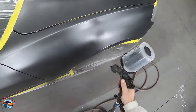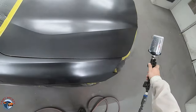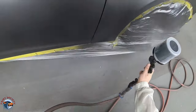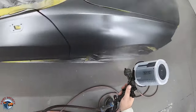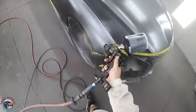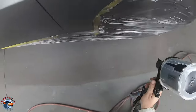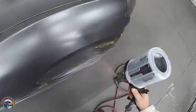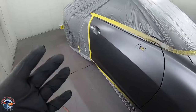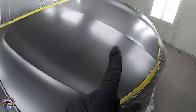I have a couple of cut-throughs — you don't need to seal these up. I'm just going to apply my first coat very, very light. This is the Walcom base coat gun 1.2, one of the best base coat guns I've ever used — it is effortless. I've got around five to ten minutes between coats to allow that base coat to really flash. In the second coat, we're extending a little bit further, going past the panel line on the fender and the door, extending to the first body line in the hood. In our third coat, five to ten minutes later, we extend three to four inches past our original area. Using an extra slow reducer, this base coat blends flawlessly and effortlessly into the existing paint. Using the right material in the base will yield a better finish in your clear coat.